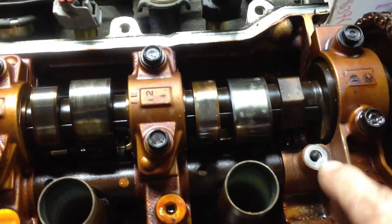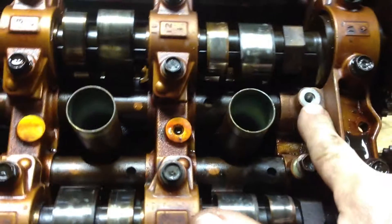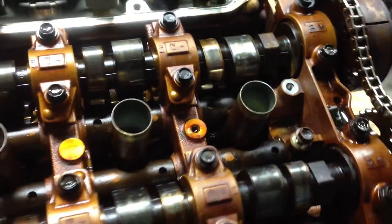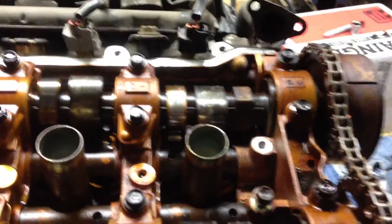When I pulled the broken piece of bolt out of this hole, I noticed it was slightly rotated — it wasn't on center with the hole. So to center the shaft up, I pulled the cover where the lift solenoid goes in. I put an easy-out in the back of the rocker shaft, and I was able to rotate it just slightly to get it to line up.